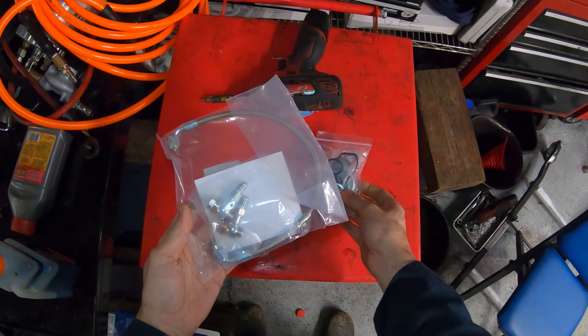This is the bushing — basically the bolt seizes onto that. Then we'll use a body clip tool to remove all these plastic push fasteners, one more for the washer reservoir, a couple more 10mms — two on each side and another one in the back for turbo cars. Then we need to disconnect the bonnet latch release Bowden cable, close this back up, and push it through the hole as we take this part off. Instead of removing the upper crash support completely you could also just disconnect it and leave it in place.